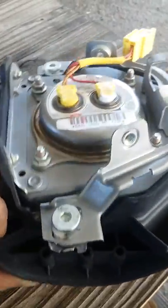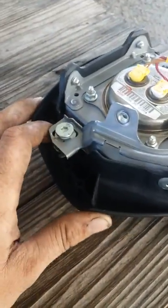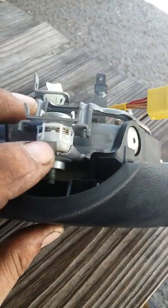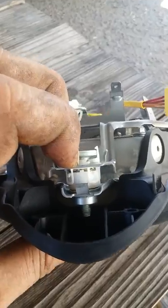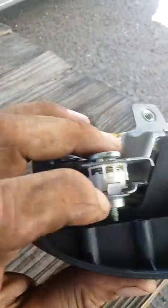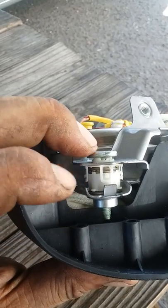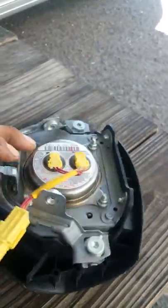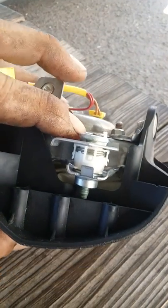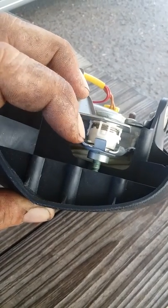I don't know if somebody punched the steering wheel because of road rage — I don't know how it happened, but they broke anyway. What I found is the one that wasn't broke was nice and square. It had a good gap to it and a good compression stroke. These over here on both sides were bent down — kind of cocked. The screw didn't want to sit up very square and there wasn't much of a stroke. The screw was pushed over because this tab right here was bent down.